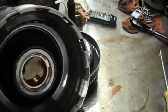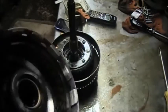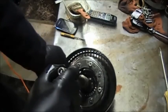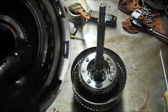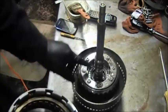You have the K1 clutches here and we're going to mesh these clutches with these splines. Just put it on top and make sure everything goes down. Make sure the washer or bearing is inside — keep it in there with some Vaseline or transmission lube — and that's going to ride on this race here. The gear on the inside is going to mesh with these spider gears or planetary gears.